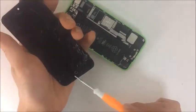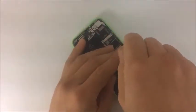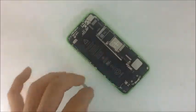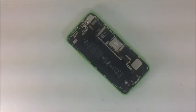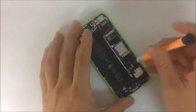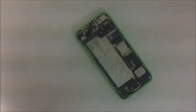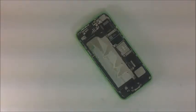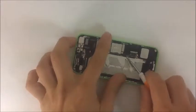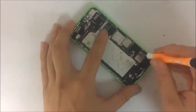We're going to go a little deeper and show some more micro parts. We'll remove this shell, which covers the battery flex and also the charging dock flex. We remove the battery flex right here — the battery comes off without too much effort, though sometimes there's a lot more adhesive and you might need to heat it. At the same time, be careful not to overheat the motherboard. Then we disconnect the charging dock — there's also an antenna connected here.